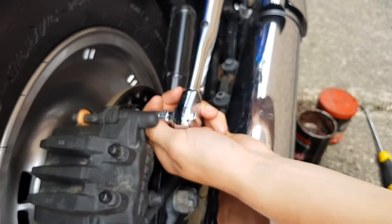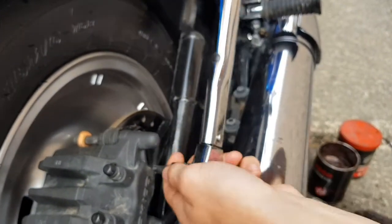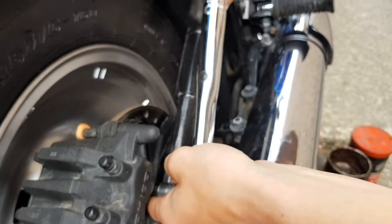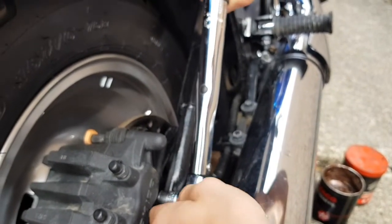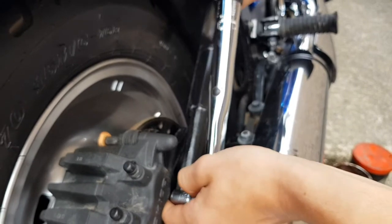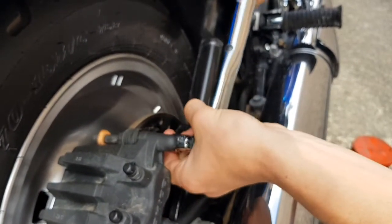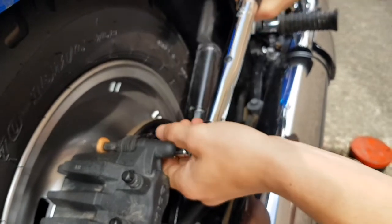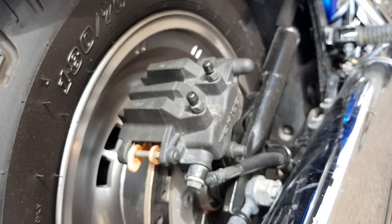There's one. So that then is set to 25 foot-pounds. So you'll just check the bottom bolt again to make sure that it's got the right torque set in. Yep. And you'll check the top one. Yep. So that's the brake disc changed on the front and the back.